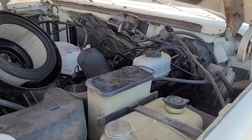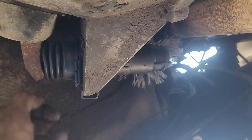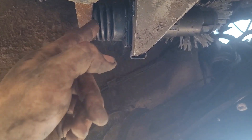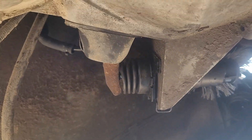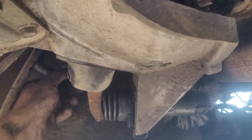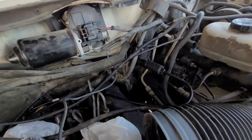I got the slave cylinder on. That's not a fun job - the piston wants to extend because there's a spring in there and it's pretty strong. It came with a plastic strap that went around but it's too long - we need it fully retracted so it really doesn't help that much. Basically you just have to push it in with superhuman strength and ruin your thumb pad. My thumb is so sore. After many tries and much frustration I was able to get it on - do not want to do that again. Now we just got to make sure our lines are in approximately the right place. The bends in the hydraulic lines seem to be slightly different from the factory ones, so we're just going to let it lie like that.